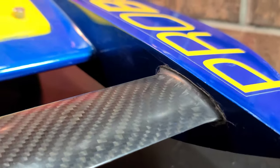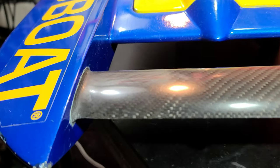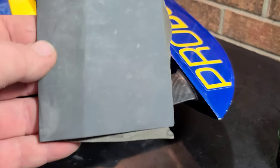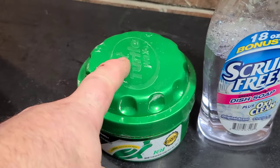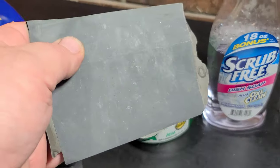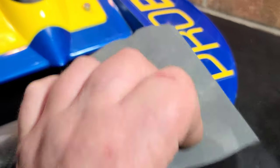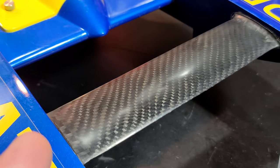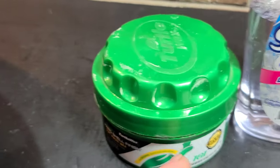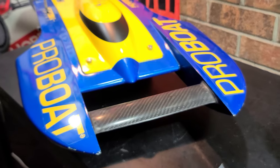I've got some spider webbing here which I'm gonna try to tidy up a little more, and same with this spot — I cut most of it out but I think it turned out good. After that coat of epoxy I basically wet sanded the boat with 220, 500, and then did my final wet sand with 1000. For the final wet sand I used wax — scooped up some wax, wet sanded it using water with dish soap to keep it lubricated — and really lightly hit it. Then I took my buffer with a microfiber bonnet and hit it with some Turtle Wax. Got it pretty shiny — turned out really good.